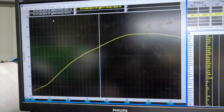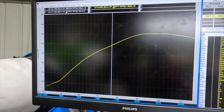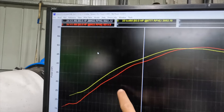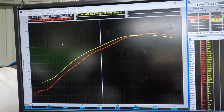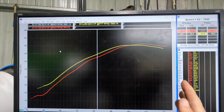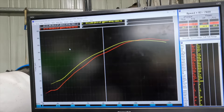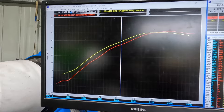Okay, so yellow is the 2023 model — made 50 horsepower. In red, this is the 2024. It's a bit softer down low but keeps pulling out a bit longer. Keep in mind the bottom axis is in speed, so if you went up a tooth on the rear sprocket you would move that red graph back a bit and it would pretty much match it the whole way and then go a bit longer than the previous one. And in blue...